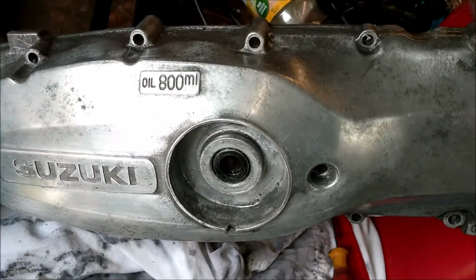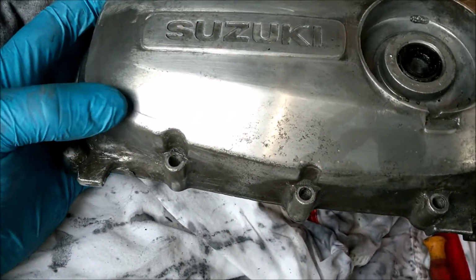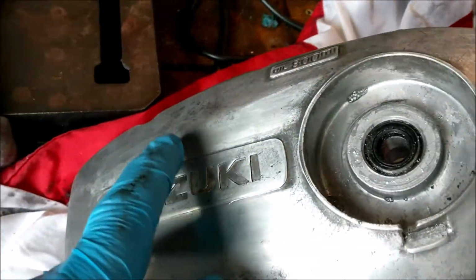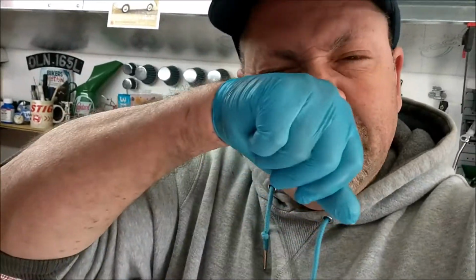But this paper is too fine. I need to get the gouges out first, and all that dark greyness, before I go over it with the 800 and then the 1200. Just pointless effort there. Wasting my precious energy.